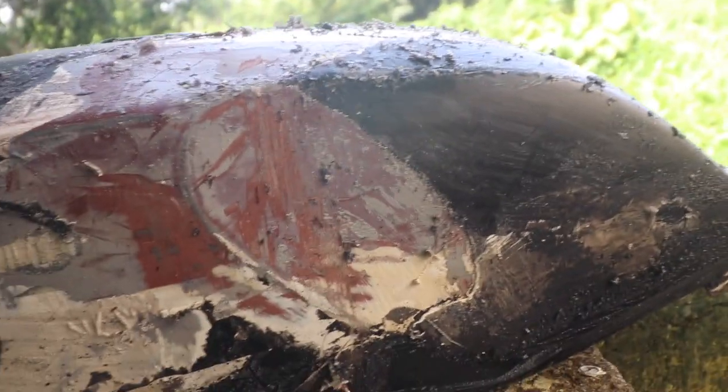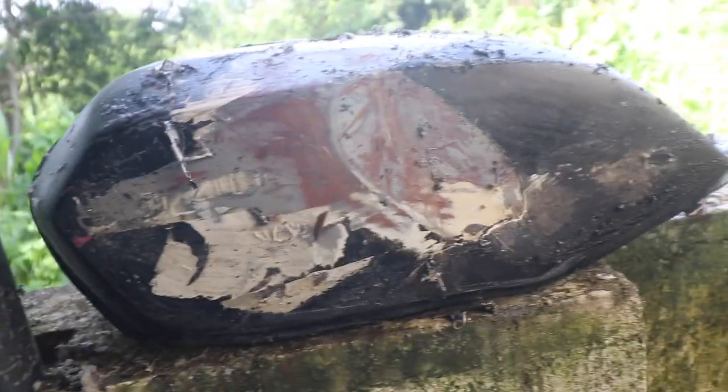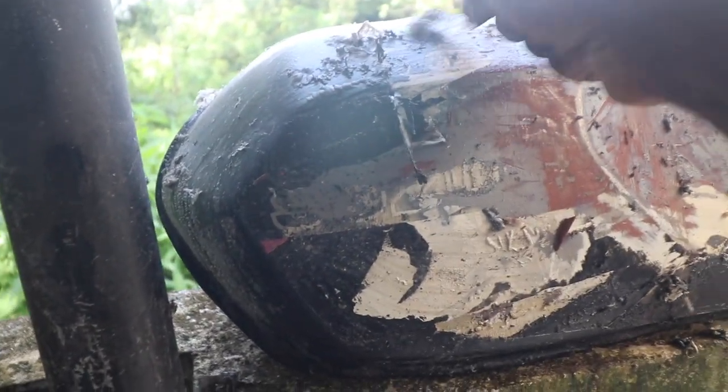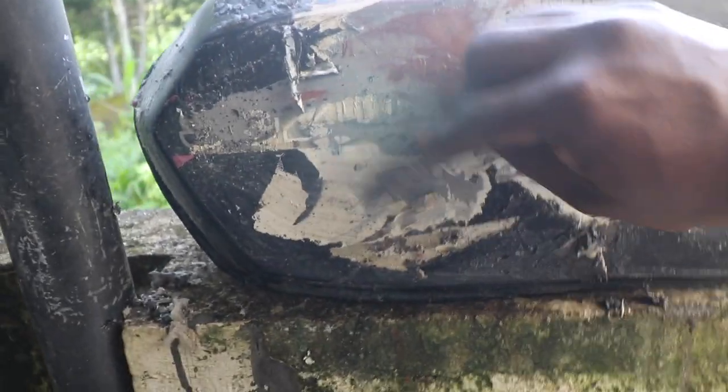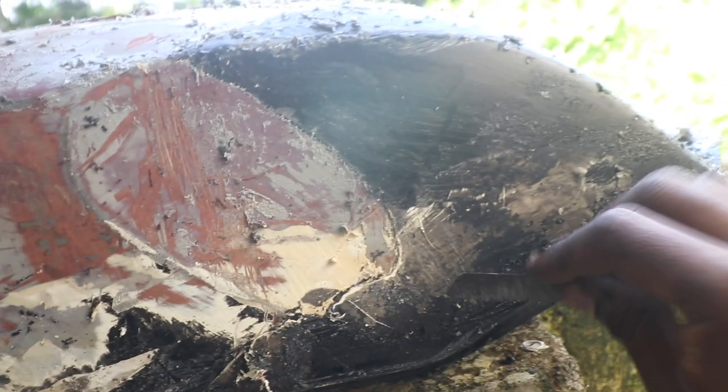It looks like a fissure — the entire thing is flaking. The next step is to scrape all this loose paint out, then apply another layer of paint remover, and then finally scrape it off to see the metal. Once we see the metal we'll use 600 grit paper all over it, then prime it again, apply at least two coats of base, stick the sticker, and apply a coat of clear. There is another challenge: around this area the tank appears to have been welded, so if I see a possibility of a leak I'll have to give it for welding again.